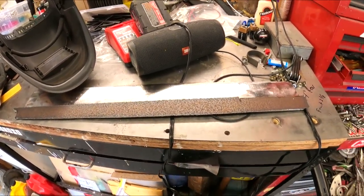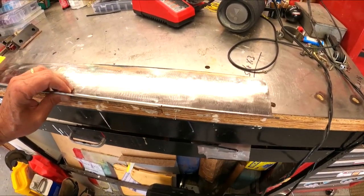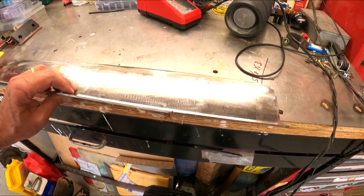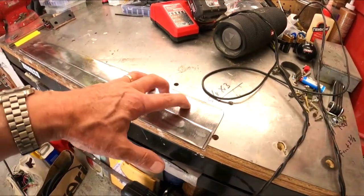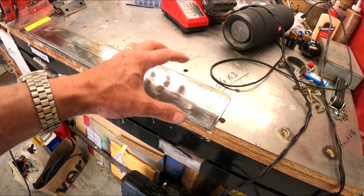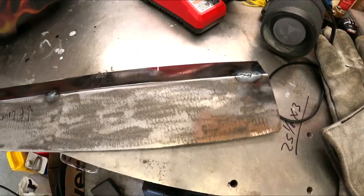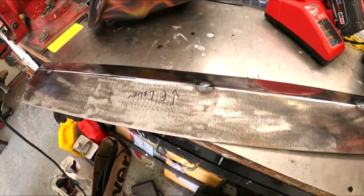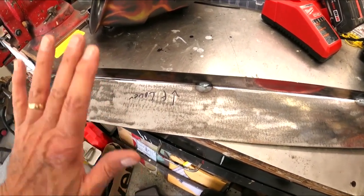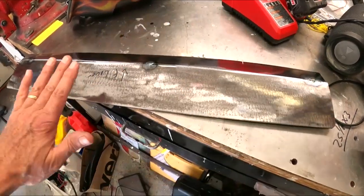Metal's all cleaned up. Now I'm going to tack the front piece onto the back plate so I can bend it a little bit to get the angle just right, then put it up in the car to figure out where I need to bend it. I'd rather not tack it directly into the car and then cut it out — I think it's easier to do it this way. I've now got the front plate tacked in three spots. Once it cools down I'll adjust the front angle to match the radiator. I need to make sure the bottom plate stays flat.